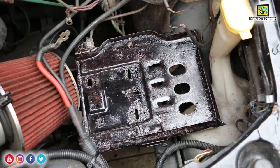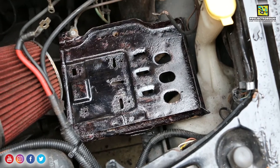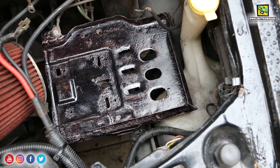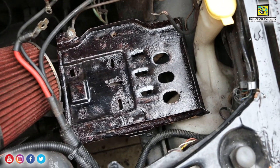I've pulled that cover up to keep the rain off. The Kurust looks like it's done its job - there are some brush strokes in this and I don't know whether you're actually supposed to sand it or not, but I'm not too bothered with it being under the bonnet. I'm going to get the zinc primer on it now and see how it comes up.